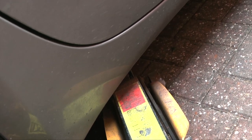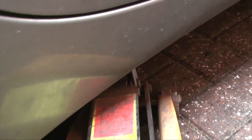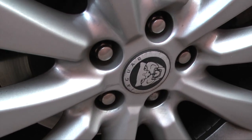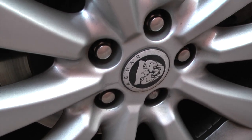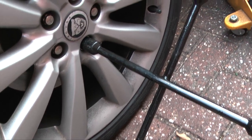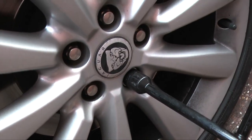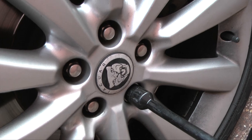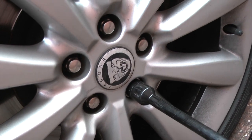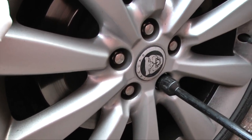The next thing you'll need to do is jack up and support the car. You'll notice there are arrows on the sills to indicate the correct position. But before you lift it up completely, just crack off the nuts on the wheel. It's a 19mm socket or wheel brace you'll need. Just start the nuts going so you don't have to apply too much torque when the car is up on the jack, because you'll have left the handbrake off when doing the brake job.